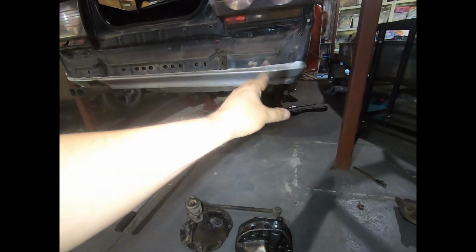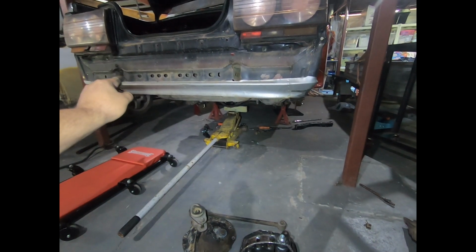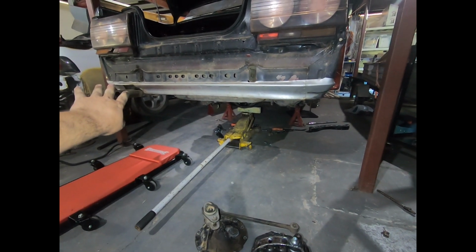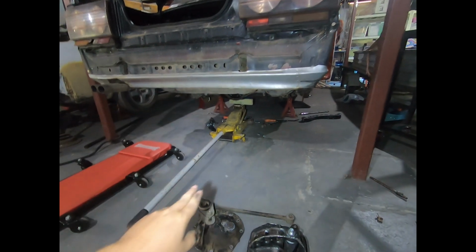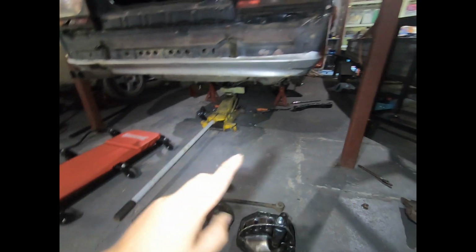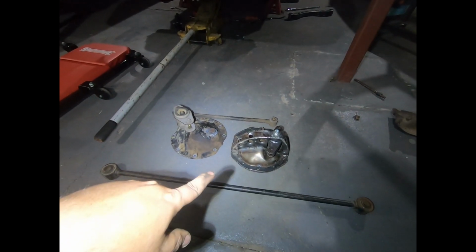And the problem with the cars being so low is that once the bar comes up to horizontal, they're actually pushed over to one side, probably like 15 mil. And with tight offset wheels on the guards, it's very hard to not have the guards rub, because you've got to flare one side more than the other. And if you tried flaring guards in a sedan, you know they're pretty hard. So what I always wanted to do was put a Watts link in the car.